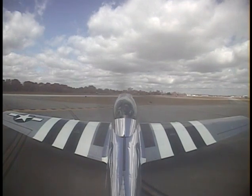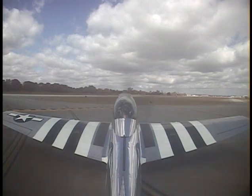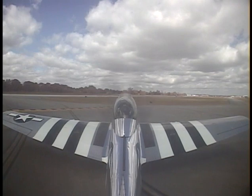So while we're sitting here, we'll do our before takeoff checks. So flap handle's up, they're visually verified up left and right. I'm locking my shoulder harnesses. Mixture's auto-rich, coolant and oil doors are automatic. Tower frequency's in, transponder's already on. My boost pump switch is already on, but fuel pressure's up in the green from the engine-driven pump. So I'm just gonna check the breaker. That's good. Left tank selected, D10 triangle.